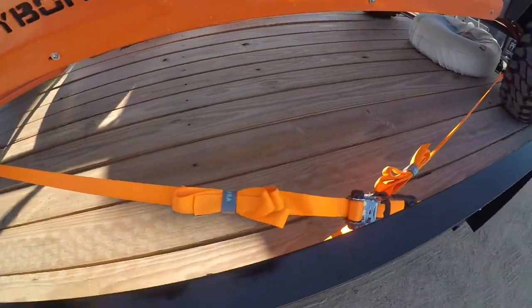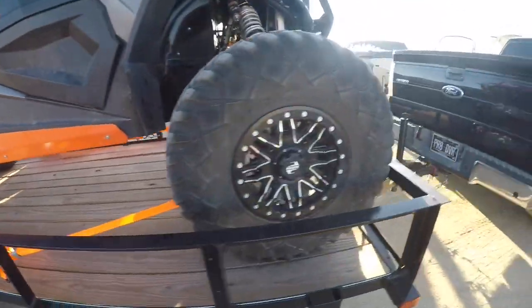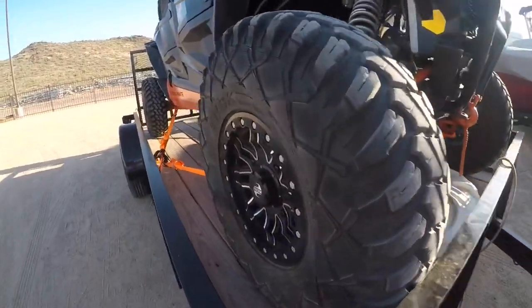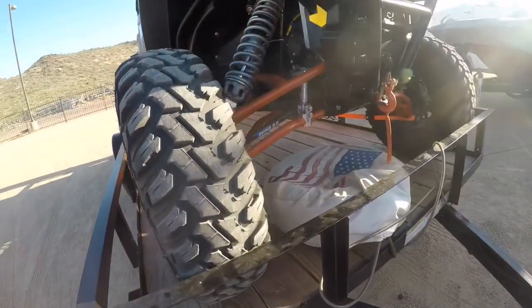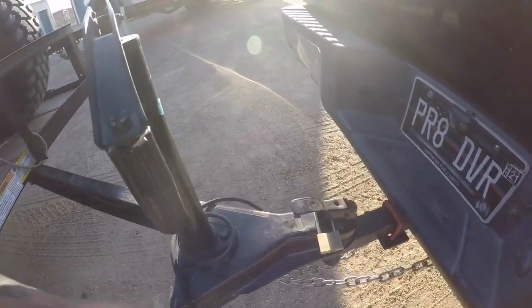Same thing on the other side. Getting everything set up, securing your extra strap, making sure they're nice and tight. Another key point: notice there are no twists in the strap. You want those straps as straight as possible — twists are bad. Centered on the trailer, front to back, and all the way forward is how it rides nicely on our trailer. Gives us a little extra room in the back if we want to load gas cans and things like that. Everything is secured and we're ready to roll. All we need to do is do our brake checks, make sure we have lights, and double check your connections. As you can see, the electrical connection is not hooked up, so we have not done our safety checks yet — that is yet to come. Thank you for tuning in, and please like, subscribe, and share. Welcome to the channel — we enjoy having you here as part of our community.